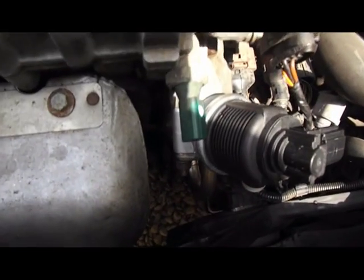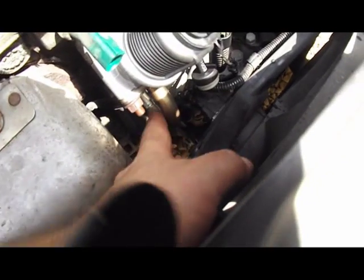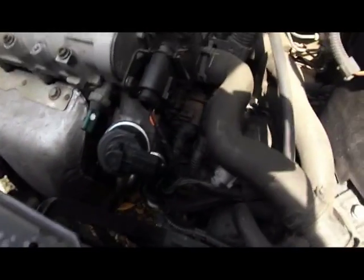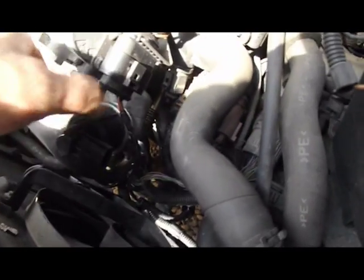Okay, and there's the EGR valve all fitted in. The nut there all tightened up, the brass one put back in place. There's a bit of play on it. It's got a ribbed section where you can move it about slightly. Go careful with it if you do it. The other nut is underneath here, and you can see it, the sun's not quite in the right place, but the other nut's there. It's just two nuts that hold the EGR valve in place, and it all just slides off backwards.